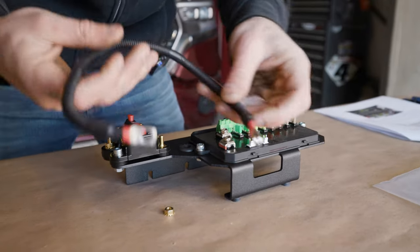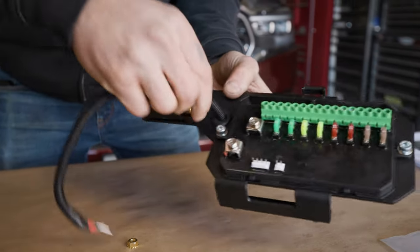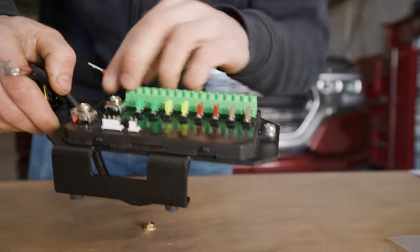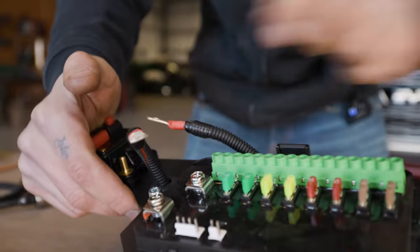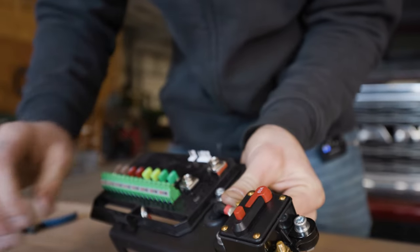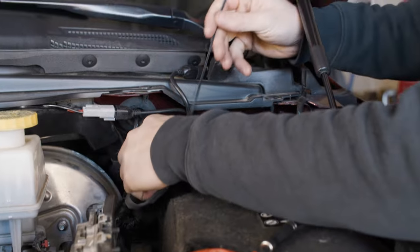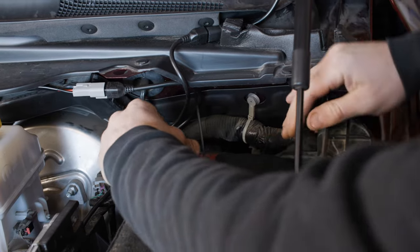Slide the shorter of the two wires down through the grommet and up through the switch assembly and attach it to the positive. Attach this end to the breaker. Using a 10mm socket, disconnect the battery negative and tie it out of the way — a zip tie works great. This will keep the terminal from contacting the connector.